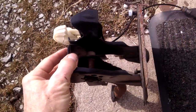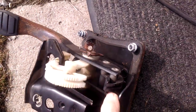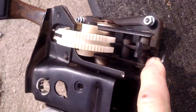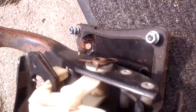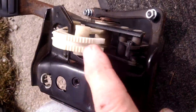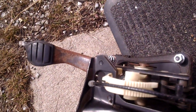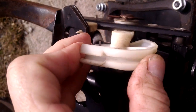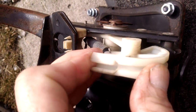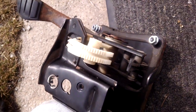A lot of people don't know that. But again, always make sure that your cable is wrapped in the groove, because your cable comes up through the hole here and then sits in the groove completely. With constant pressure on the throw-out bearing, this automatically adjusts as long as this piece is not stripped. And that's how it works.